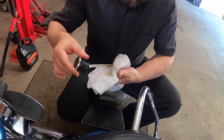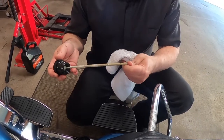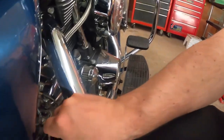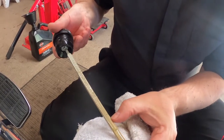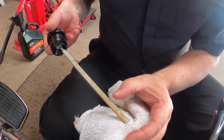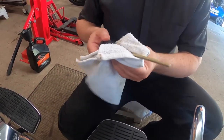Check your level upright — push the dipstick all the way in, pull it out. We're right there, which means we're about right. You want to be about halfway on a cold engine because the level will rise. Harleys don't like to be completely full, so you want to give it a little space. About halfway is what's recommended by most Harley guys.